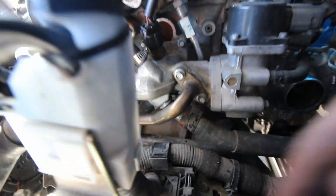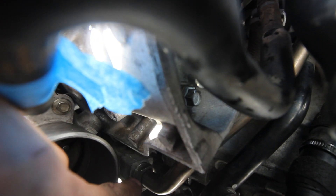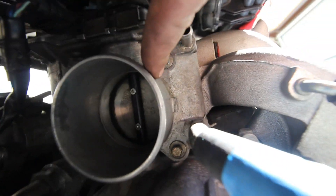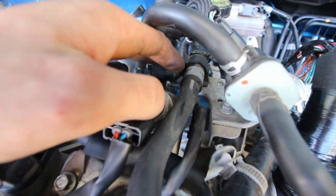On the driver's side, I put in the EGR tube, connecting it with a 22-millimeter wrench on one side and two 8-millimeter bolts on the other. Next is the throttle body, which is close to the EGR tube — four bolts go back on, then we reattach the coolant lines. I also replaced the vacuum hose line, clamping it back in on both ends, along with the line with a blue collar.